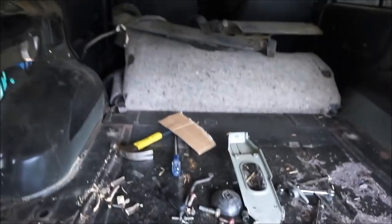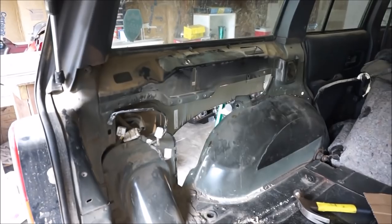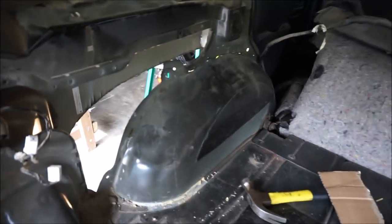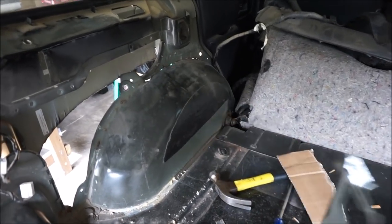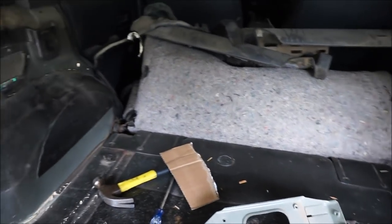Oh, by the way, you're definitely going to want to strip out all the interior pieces. Pretty self-explanatory. Take all the plastics out. It's just a few screws. I took out all the seat belt assemblies. Those were T50 Torx bolts. I even took out the spare tire bracket. I'm not going to need that stuff anymore. So I stripped that all back and then of course pushed the carpet back.